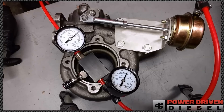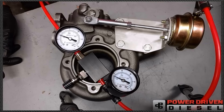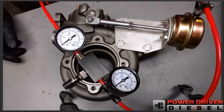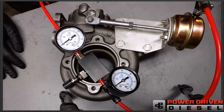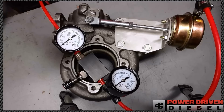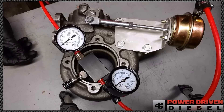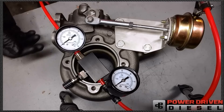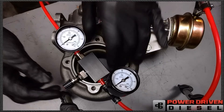So that's going to speed up your response a lot — but maybe that's not enough. Maybe we want a lot more than that. Depending on your fueling setup, that may yield 40 to 45 pounds of boost — I'm not sure. But you'll be able to play with this while you're driving. Give it full throttle, see what it does, let off, make an adjustment, floor it again, see what it does, let off, make an adjustment. That's how you tune your turbo.